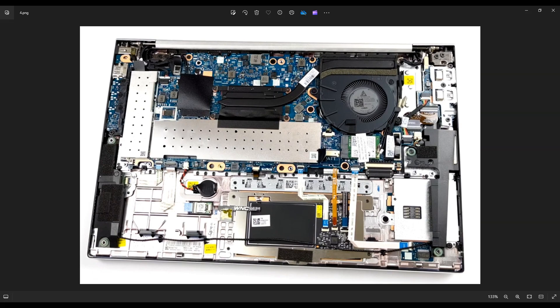The next thing I'll shout out is your CMOS battery. After you remove your main computer battery, it exposes your CMOS battery. This is wrapped in black electrical tape and held down by double-sided tape, so if you want to replace it, that can easily be popped off — it plugs into the motherboard right here. Try not to pull on wires; put your fingernails or a pry tool on either grip on that plug and jimmy it out of that port. As a side note, if you're here to reset BIOS by unplugging the CMOS battery for 15–20 seconds, that will reset a lot of your BIOS system settings, but in most cases it won't reset your BIOS password — just an FYI.